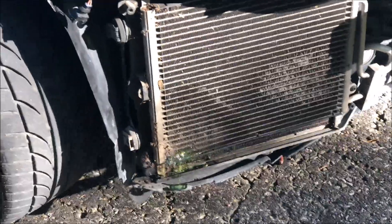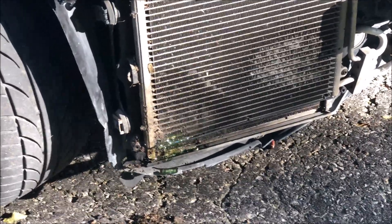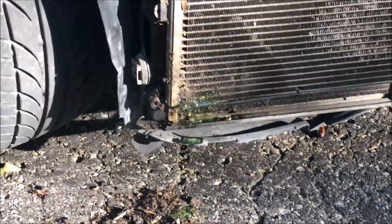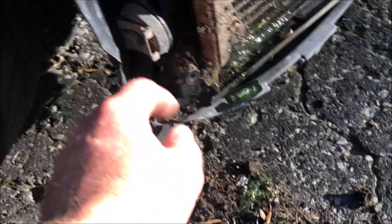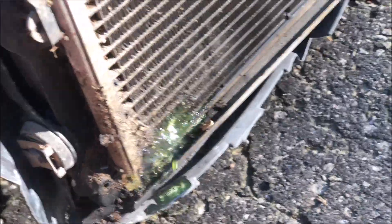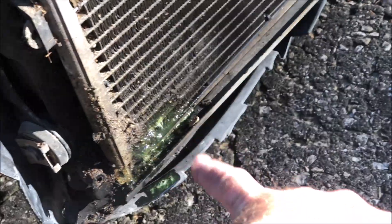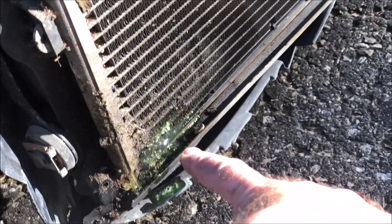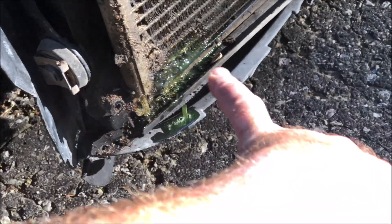It's a 1998 Porsche 986 Boxster. I have a feeling I found my AC issue on the front—there's a condenser on the front. It looks like what happened is road debris got stuck up behind it and corroded it, or it got to the wire wall. It's pressurized, so I'm going to get one of the detergent cans to find out where we're leaking.